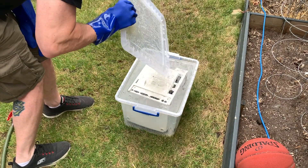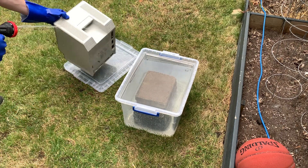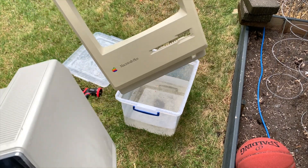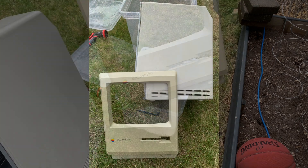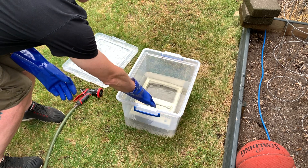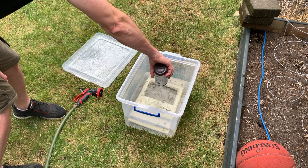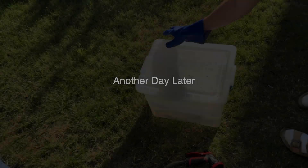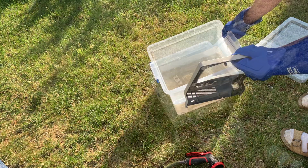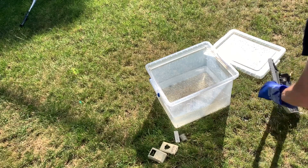It's a day later and I'm checking it out to see how it worked. I moved the bucket around a bit to give it maximum sun exposure on all sides. Rinsing it off now — as you can see, there's the bezel that hasn't been done compared to the case that has, and it's quite a bit whiter. The yellow is mostly gone. I put in another bottle of peroxide to increase the strength a bit for the bezel, let it sit for another day, and there we go — the bezel is quite a bit lighter. I also did the mouse case and gave it a good rinse.